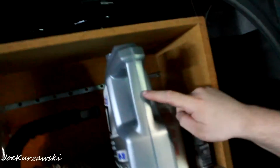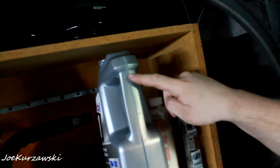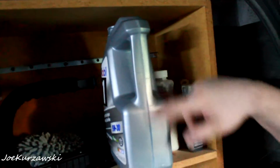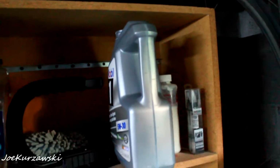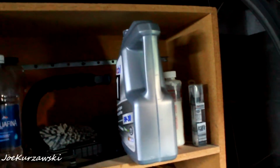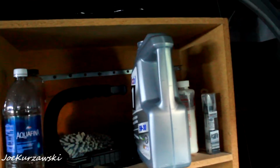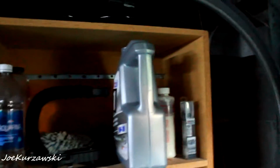The car should take 4.5, and I always add another half because of the oil cooler. So that is a little bit low, and racing probably gets all that blow by and pushes it out. And the couple times I've emptied my catch can, I probably should have been double checking that dipstick, but it was never below the minimum when the pressure never dropped, so that's always important.